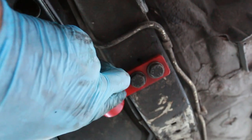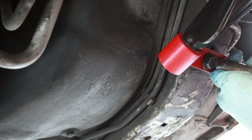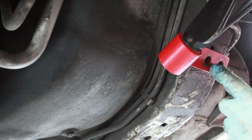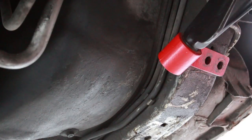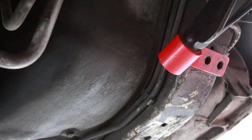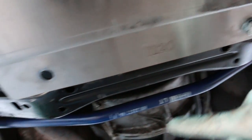Let's go ahead and take these bolts off so we can get this cross brace on. When taking off these two 17s, make sure they don't pop off. If these pop off, you kind of have to drop your control arm for these particular mounts. Regular lollipops aren't such a big deal, but these solid-mounted ones can be more of a pain to get back on. Now we've got these bolt holes off here and here.